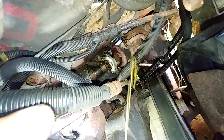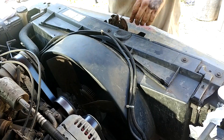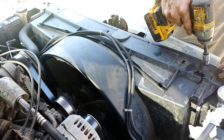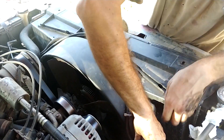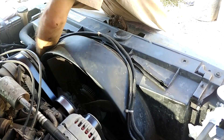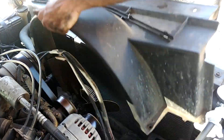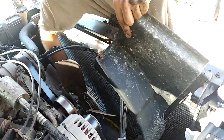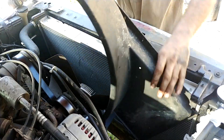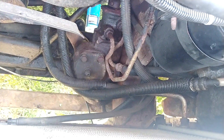Here I'm pulling off the plastic cover so I could get to the power steering lines. Let's also remove this fan shroud, as it doesn't look like the power steering pump could come out any other way. Try not to damage or fold in any of the fins on the radiator, as that would affect the efficiency with which the car cools — it affects the airflow going through the radiator; more restriction means less airflow.